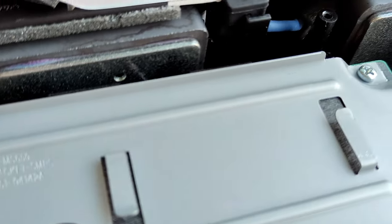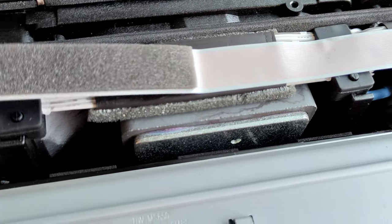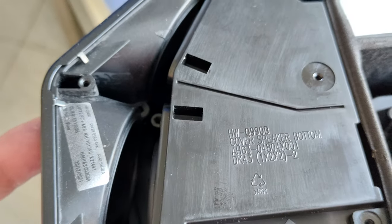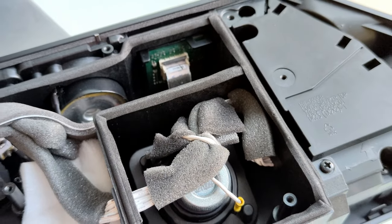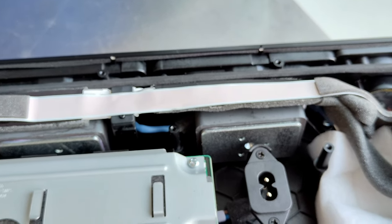between these two racetrack drivers. And on the other side, the same configuration repeats. I mean, the tweeter is outside, and then we have two racetrack drivers towards the center. So there are three channels in front, and then one channel for Atmos, a second channel for Atmos, so we count five channels. Then we have probably two independent channels with two drivers, one, two, from one side, and the same configuration repeats here. So we have nine channels, but you see the front channels are very powerful. They consist of two racetrack drivers and one tweeter per channel.